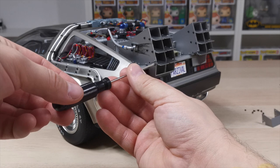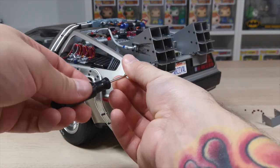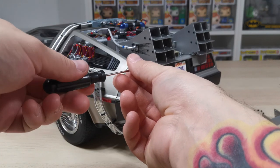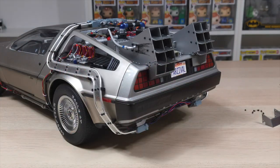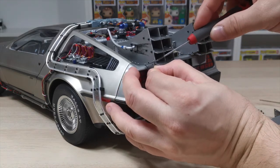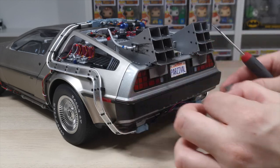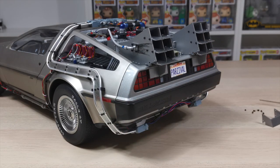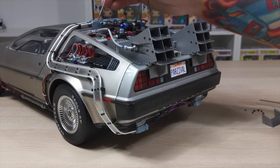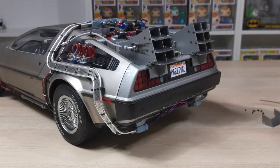The next thing you need to do is just do the other side. These exhaust cowl bottom ends are holding the back plate onto the vehicle, so you need to get those off — just push it lightly with a screwdriver as you can see here. You can mask anything up that you worry you might scratch, and they just pop off just like that. We will fast forward through a few bits but hopefully you'll be able to see enough to know how to strip it down.